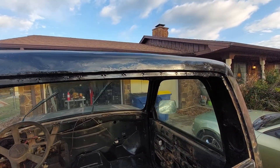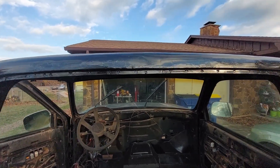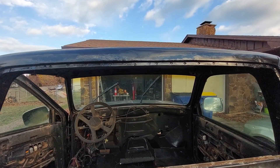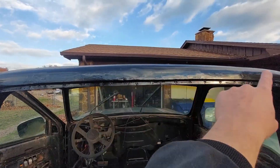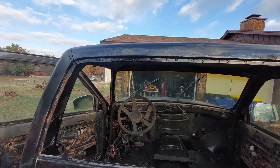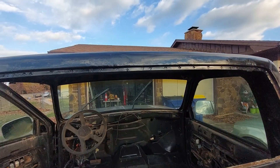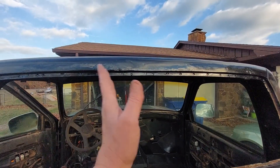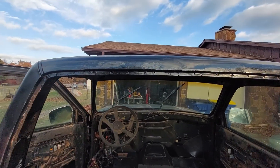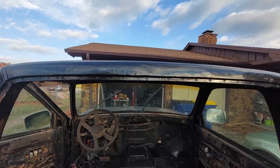I do want to make it look a little nicer than that — it looks pretty hokey. So I'll use a urethane primer and then a filler to get it smoother. I'm not worried so much about getting the dents out — there's a dent up here, there's a dent here — I'm more worried about getting it to at least match the patina of the truck. Once I get that done, I'll shoot it with some gloss black and put a clear coat over it, and at that point I'll be ready to have the rear window reinstalled.